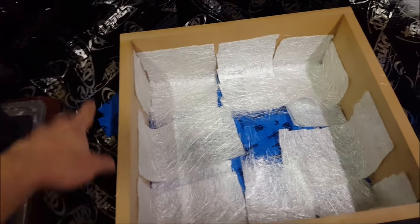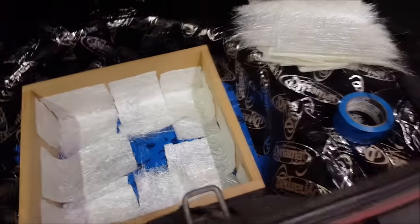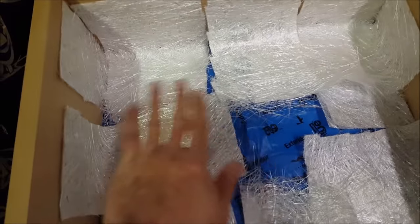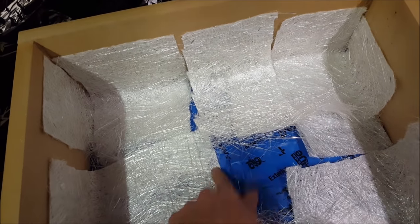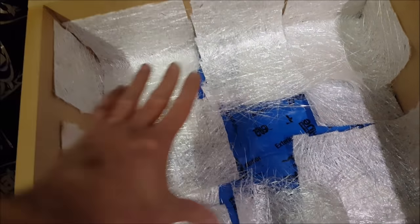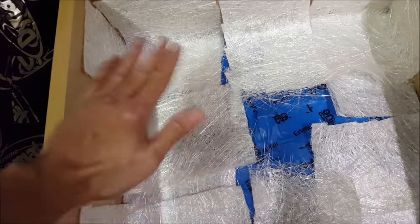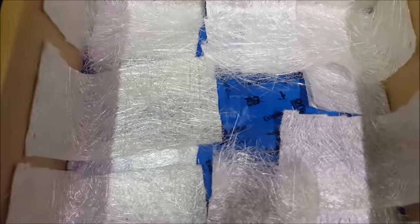I'm starting to build my enclosure now. I built a perimeter — I start with the height, cut it all on the table saw, then cut the lengths so I get the height as exact as possible. On the sides it's screwed and PL Premium together — I pre-drill, countersink, then put a screw in. The screw just holds until the PL cures; if you don't pre-drill you'll crack the wood. I decided to do a fiberglass bottom rather than a full wood box because the floor is very uneven and in older cars if there's a leak, a purely MDF enclosure will get ruined. The fiberglass bottom will never be affected and will contour to the floor perfectly.